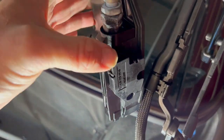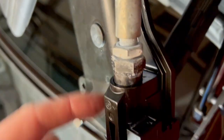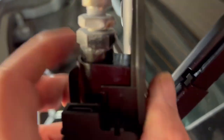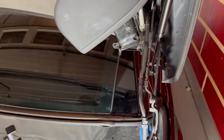Let's see what we've got here — got the new piece on. There you go, you see the new piece. There's your electrical connector goes here. On the backside there's a Torx — you can see that one there, and there's one down at the bottom. There's a hole right in here and the rack is there. The tricky bit is there is a slide — the rack goes inside and there's a gear inside there. The gear and the rack control how tight this flap is. The tricky part is getting this piece lined up. It's three pieces trying to juggle all at the same time. Start one of them and allow a little bit of movement with the piece, and you can tighten that Torx on the back with your other hand. Everyone always makes this look so easy in videos. But essentially, that's it — we'll put this back, plug it in, and that should fix it.